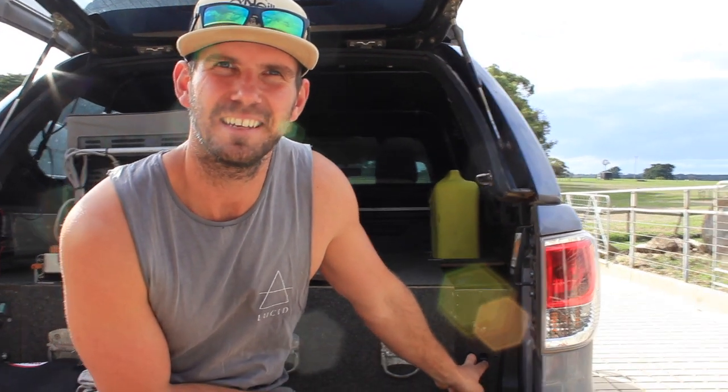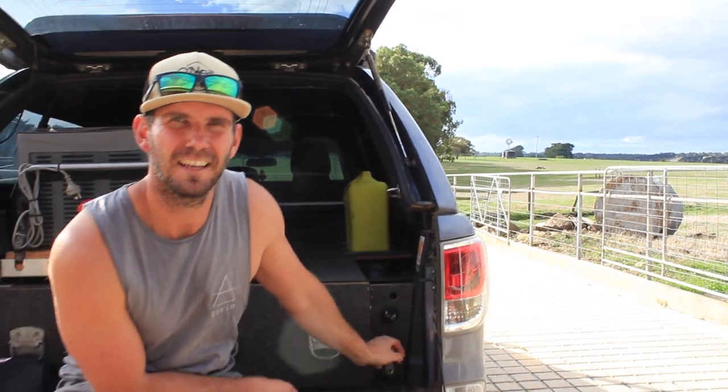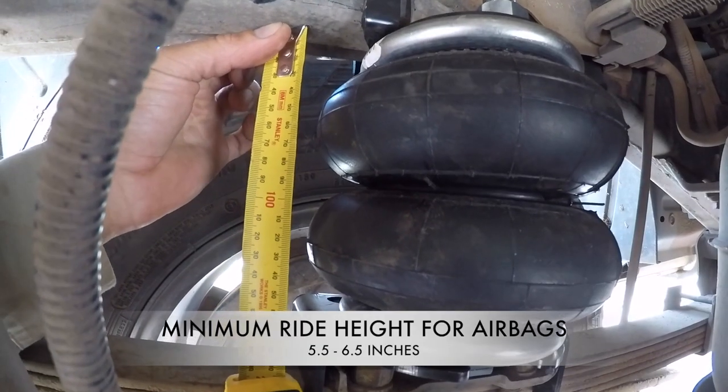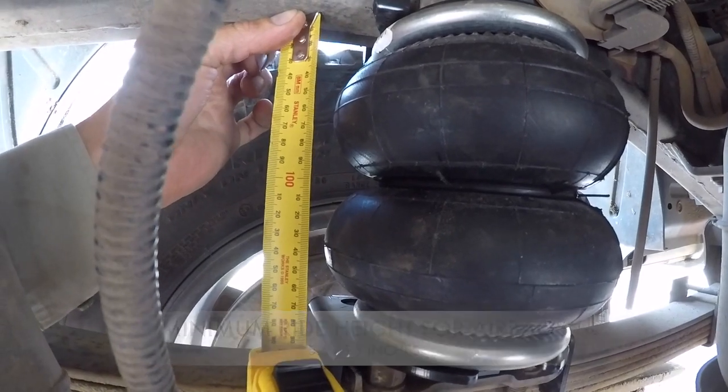You can even press them the other way — down we go. It's a good thing, because with these bags you've got to keep 5 or 6 psi in them at all times to keep them healthy, so you can just drop them straight back down to 5 or 6 without having to put a gauge on your outlets down below and all that sort of stuff.